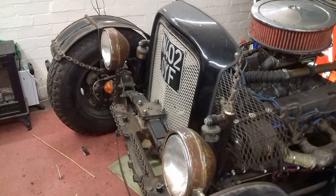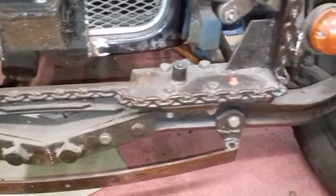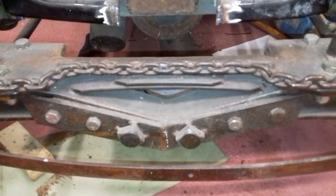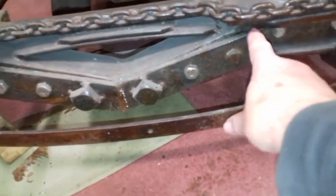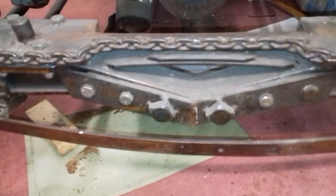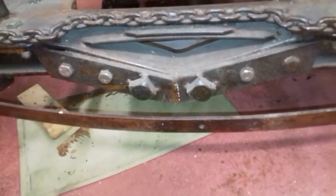I think the best thing to do is I'll show you around. Excuse my wobbly hands though. Right, here we go then, it's the LDV axle. And you can see probably here, this is where it was cut and joined again. I've done it sort of belt and braces really. It was cut there, then welded back together. Then inside, you can't really see it, but there's another plate welded in here, same on the back, and these plates here are actually bolted right the way through. I think if I remember right, these actually picked up the original holes.